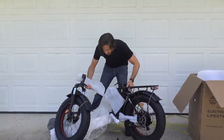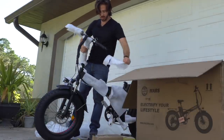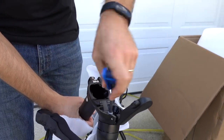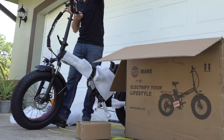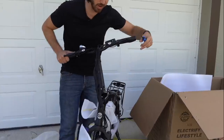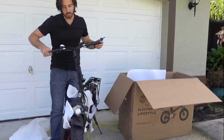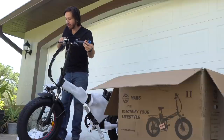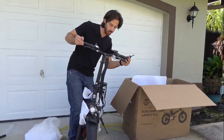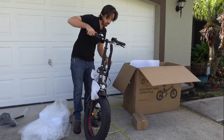Things are starting to come together here. You can already see these nice big fat tires. Let's see if I can get these handlebars connected. With these threaded headsets it's a little bit of trial and error to get the handlebars lined up just right, especially with this folding mechanism that folds at like a 45 degree angle. Sometimes what I like to do is get it fairly tight and then just turn it the last little bit while it's still tight and then tighten it down the rest of the way. There we go, nice and straight.